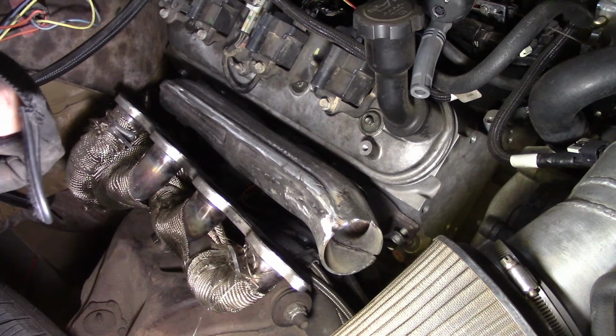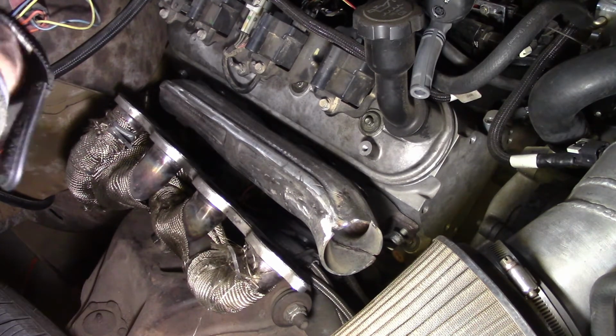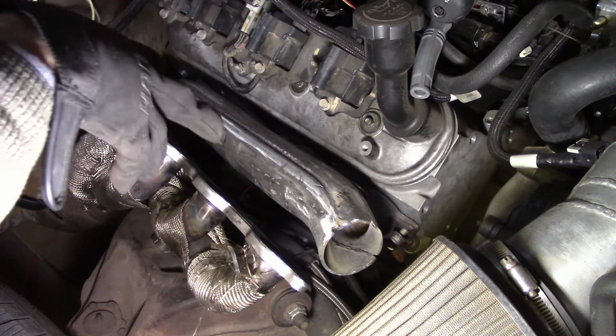You know, I've never stick welded before. The strike to start's a little bit different. It's kind of like TIG welding. I learned I had to get my amperage and voltage correct to get that strike start to work right. So I've got a video of that. I'm gonna lay that down here in a minute, how to stick weld and why I use Muggy Weld, because that has turned out nice.